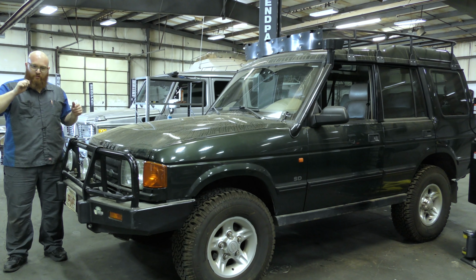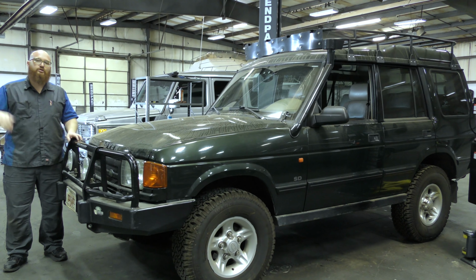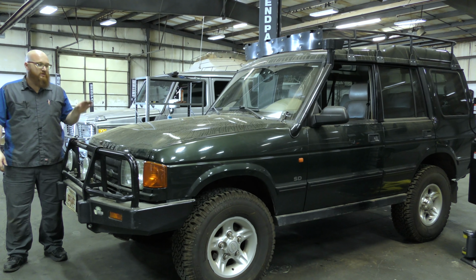If you go out and you go to start your car and it just clicks, check the battery terminals. Don't just call a tow truck and bring it to the mechanic. Check the little stuff first. You might save yourself a pretty hefty bill.